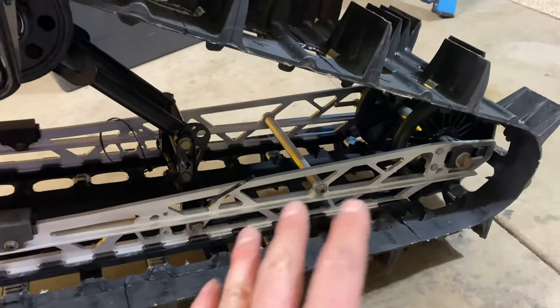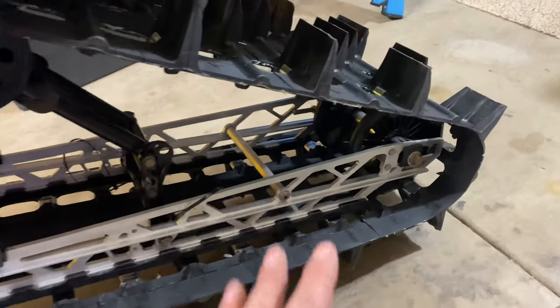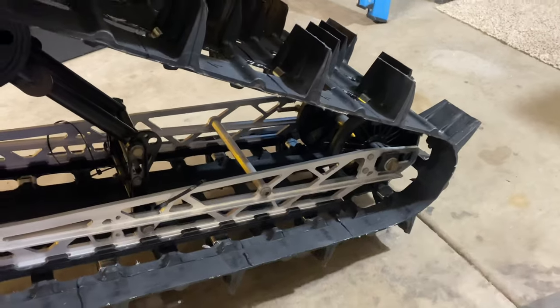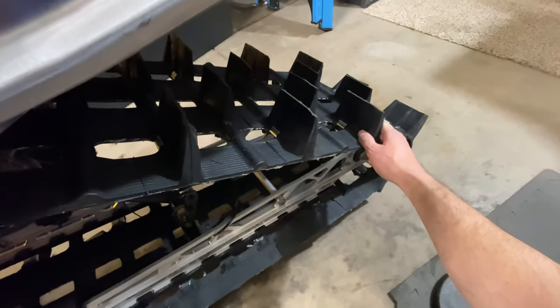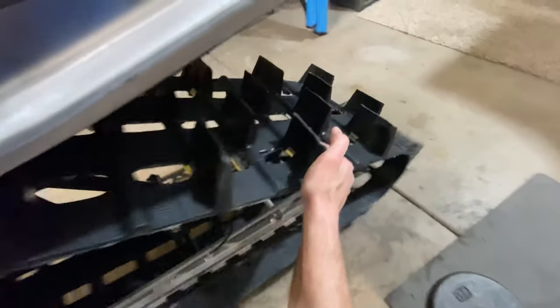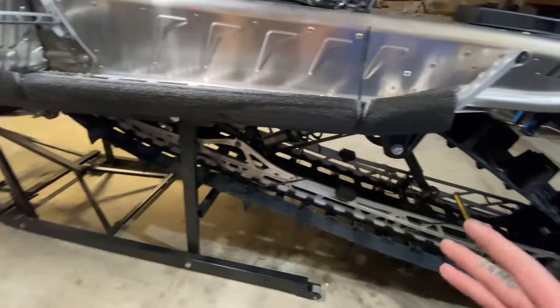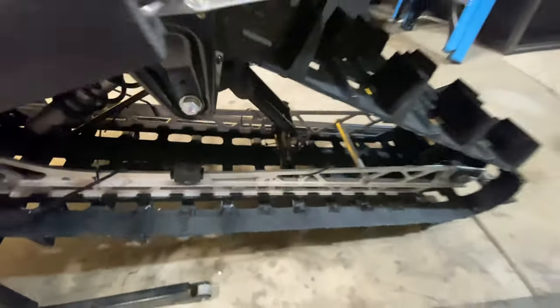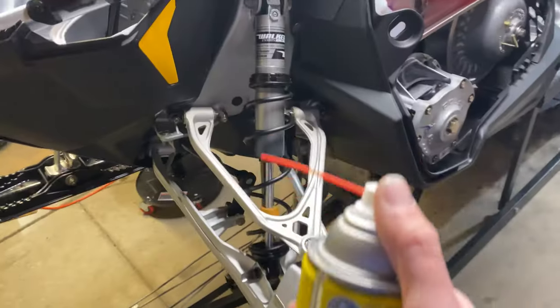I've got equal clip showing on each side now. Both sides set — we're at one inch, which is on the tight side of the spec, but it's going to stretch as we ride tomorrow. So glad I did it though; that misalignment would have eventually made the whole track permanently misaligned. With this loose tension, the rolling resistance is so minimal — I've never been able to spin it with one hand before. It's over a half inch looser than last year. It's going to free up a lot of horsepower.